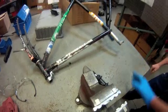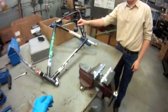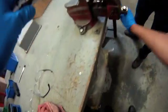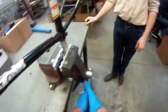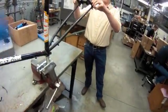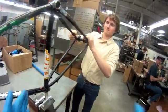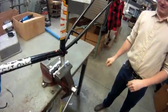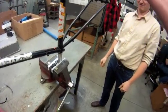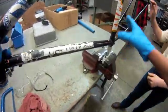We're going to attempt to remove the post. Step one: a good solid vise bolted down. Let's take our frame and put it right in our jaws — crank this thing down tight, very tight. There's going to be twisting going on and we don't want to ruin our frame. Max is going to install our rear hub to secure the stays together and make that a unit. We're going to first twist, then one person will pull upward with force — one vector going upward, the other moving along the axis of the post.